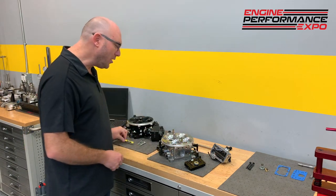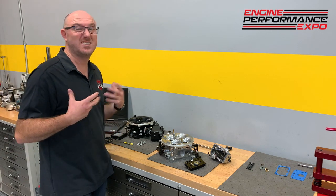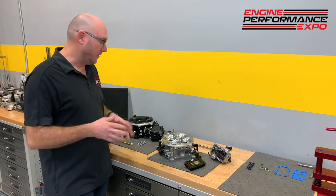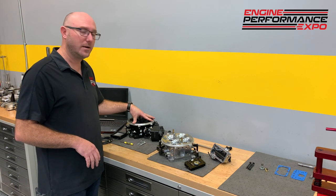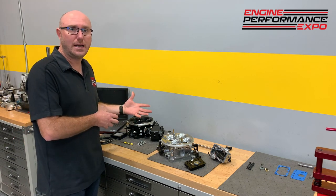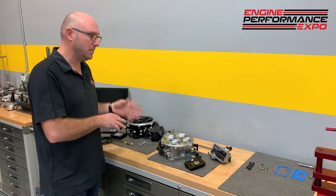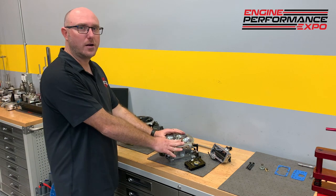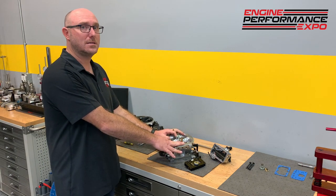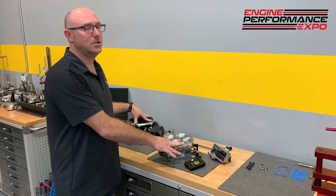So even though eventually we got to the point where we could make the same amount of power on the dyno, the difference was, in my Holley Terminator X4500, I just put a couple of parameters in and asked a few basic questions, which I answered. The engine started and ran, and it had a tune-up that was super close. My carburetor started up and ran, but in order to get it to make the same kind of power that EFI did, it took a lot of work.